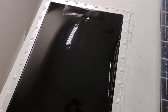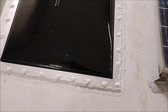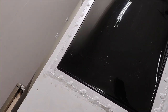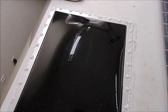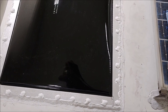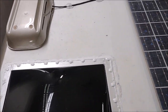There she is — completed. I went around the screw heads and then just a little bit along the top edge and let it level over and flow down to meet the butyl. I don't think butyl has much sealing power outside of being sandwiched between something — just having butyl exposed out in the open isn't the same as Dicor. It's sandwiched between all the layers which is great, but I wanted that extra insurance around the perimeter. At the closest point I'm a good inch away from the Lexan of the smoked skylight, so I put Dicor around all the screw heads and just draped it over the edge — it's now flowing out over the sides. This project is done.